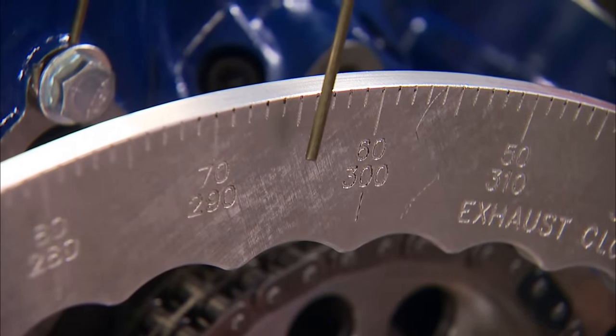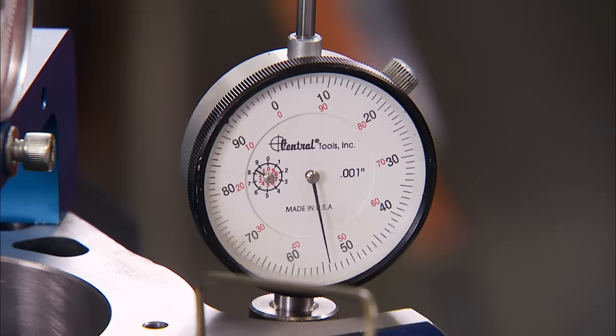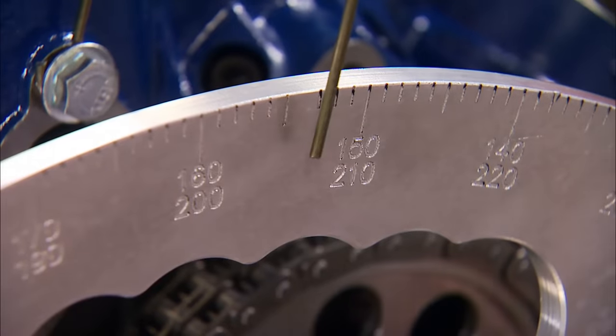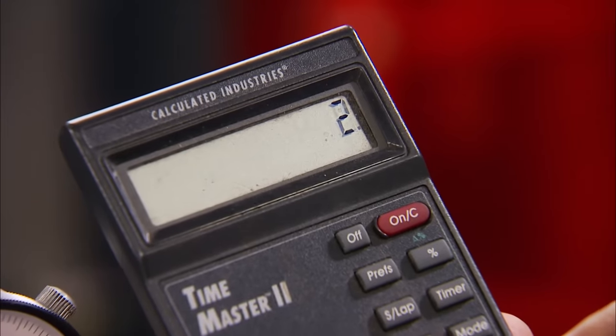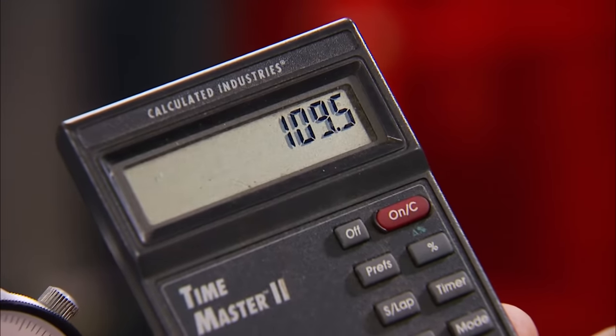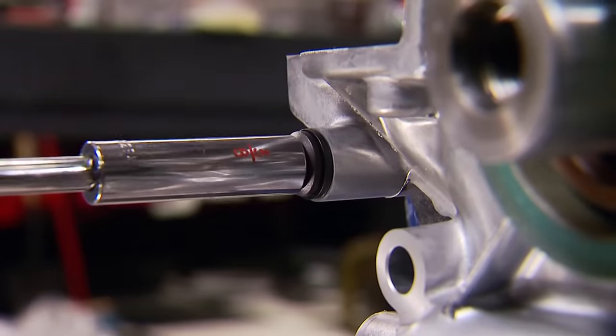This time, our first number is 65, and when we go back the other way to 50 thousandths, we get 154. Those numbers add up to 219, divided by two we get 109.5. Since you can't make that small enough of an adjustment, we're close enough.